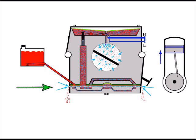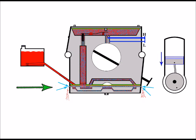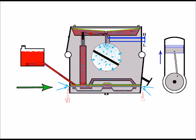And the air will work its way into the carburetor, something like what's shown here in the animation. There'll just be a continuing, constant supply of air coming in through that area, and the result of that is too much air coming into the inlet area of the carburetor through to the engine. And again, we've got a fuel to air ratio here that's weak in fuel, so there's too much air to fuel, so at this point the engine would most likely bog down. That's if it runs at all. And again, it's all because of this cap being slightly loose, because this screw's slightly loose, allowing air to fill up all the way around these fuel vanes and up through the top here and down into the engine.